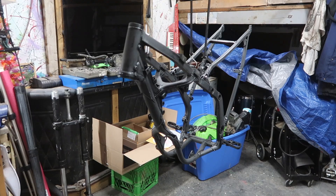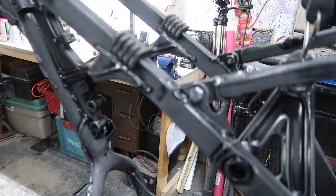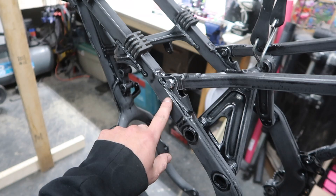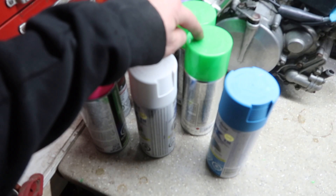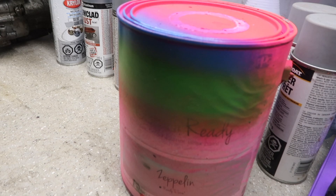Here's the 1990 Kawasaki KX125 frame — I got it all stripped down, all the paint sanded and scuffed up. The previous owner painted the frame black and had it sandblasted, so there's no lime green from the original paint showing through. The frame and subframe are in great condition, all scuffed down and ready for the custom paint job. We're going to lay down lime green, fluorescent pink, and ocean blue — a fade with pink up on the head stem, then blue, then lime green. It'll make purple where they blend together.